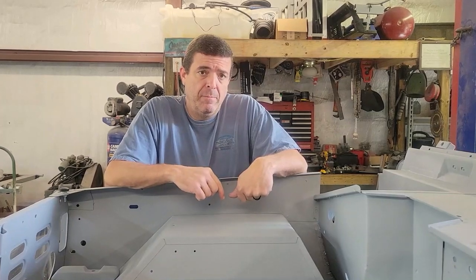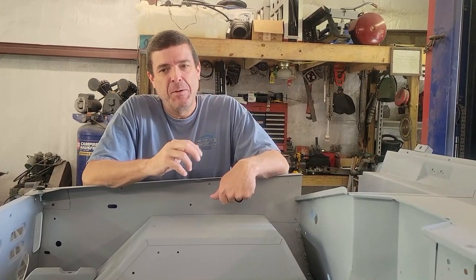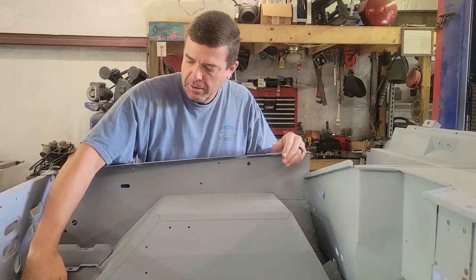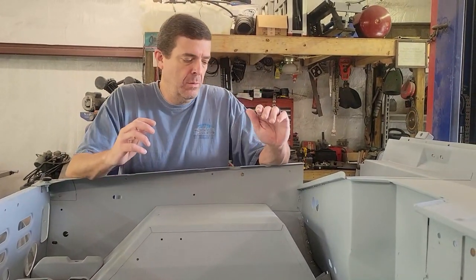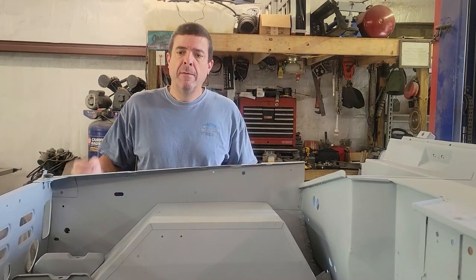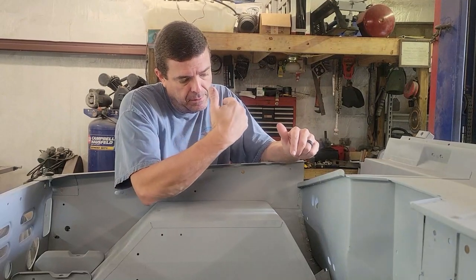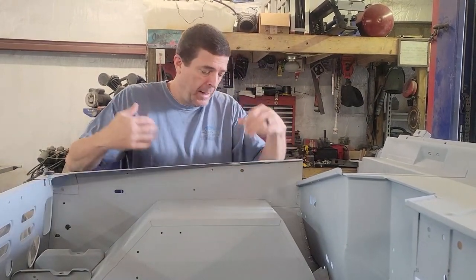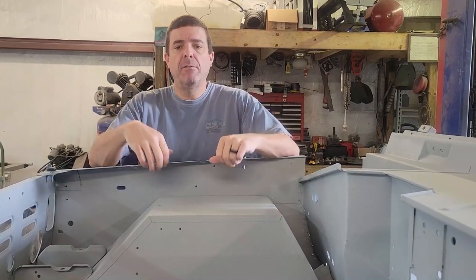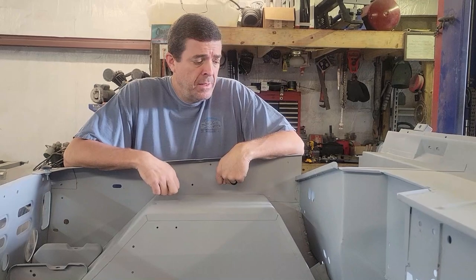So I'm going to change them. What I'm going to do different is when I pull these out, I'm going to bolt them in. These things are spot welded in all along the edge, and then spot welded to your front braces at your core support. It's no stronger than a bolt, and I'm going to put quarter-inch bolts all the way around it. That way when it comes time to paint, I can pull those out, paint the wheel wells, paint the firewall, and then bolt them back in. You'll never see them because it bolts from underneath - it's a pinch lip all the way around the bottom. Put the fenders back on and you'll never know it unless you're underneath the Bronco.